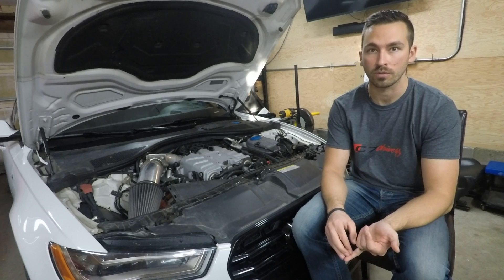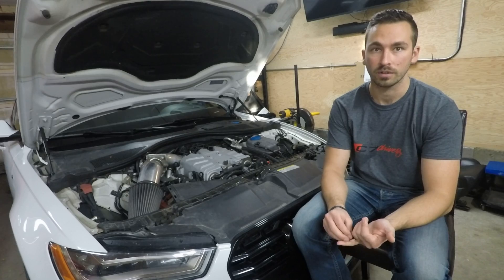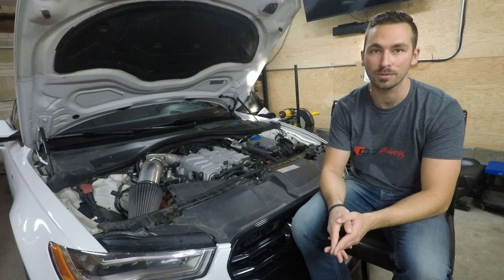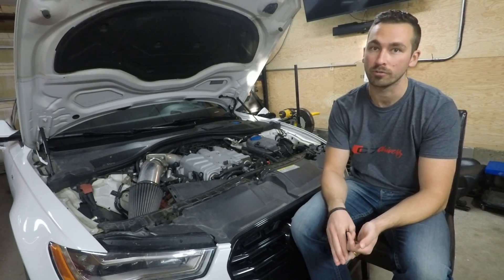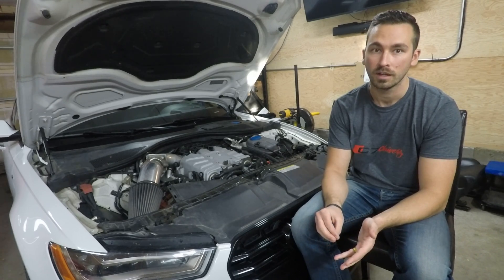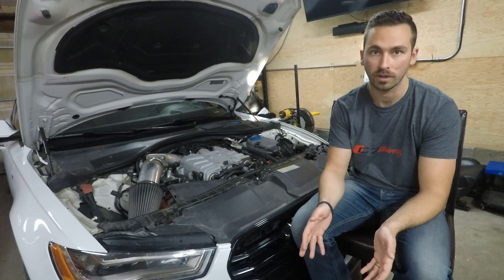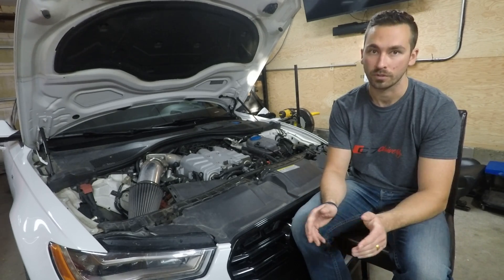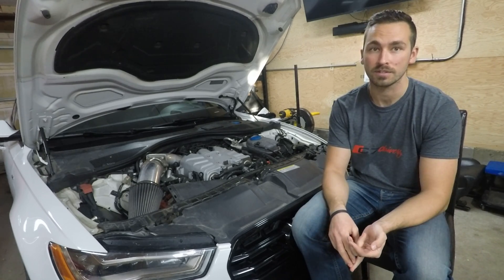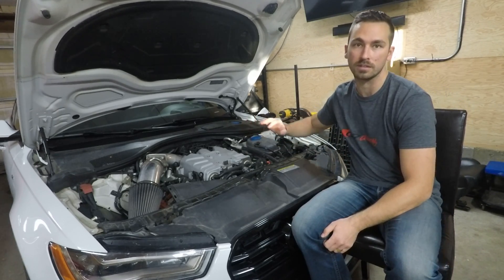Something else with that divorced reservoir: it should have a vented cap, to avoid over-pressuring the loop. The weakest link is our two intercoolers inside the supercharger — they will pop and you'll be replacing them more often. You're also damaging your engine with a pressurized system blowing coolant. When those bricks fail and you're leaking coolant through your intake valves into your cylinders, you can kill an engine. The OEM cap here relieves pressure when it exceeds 22 psi.